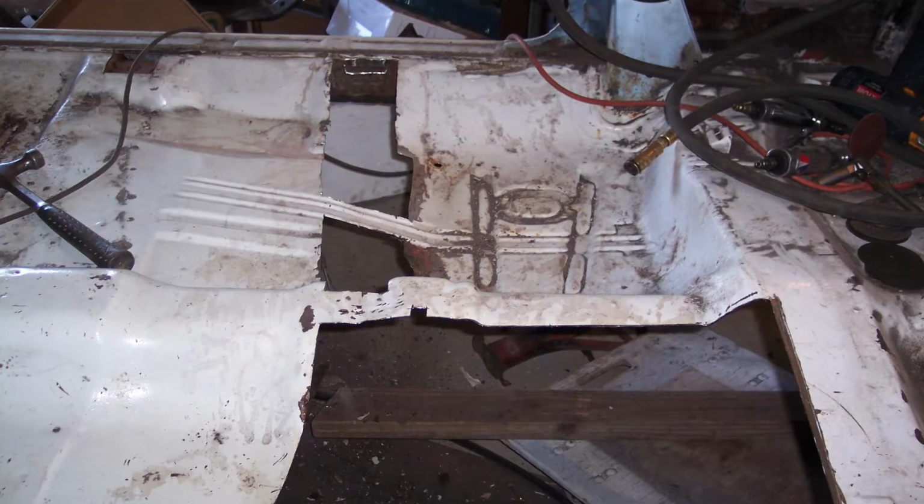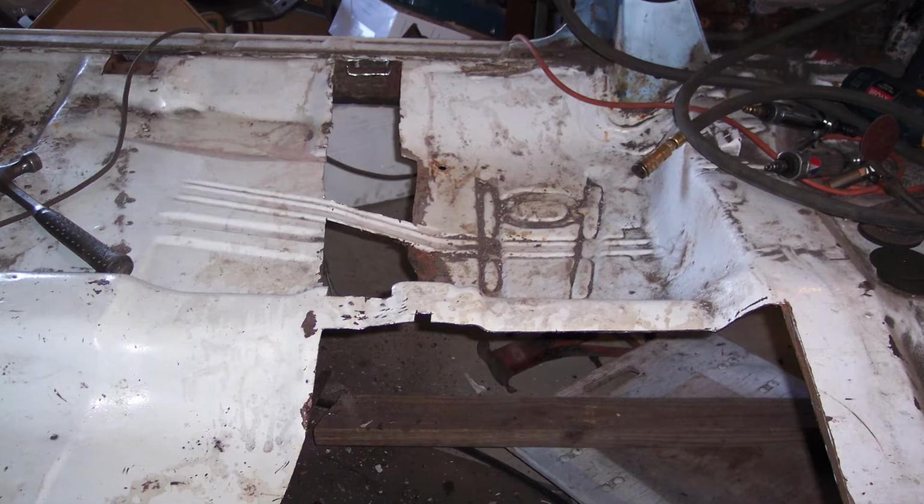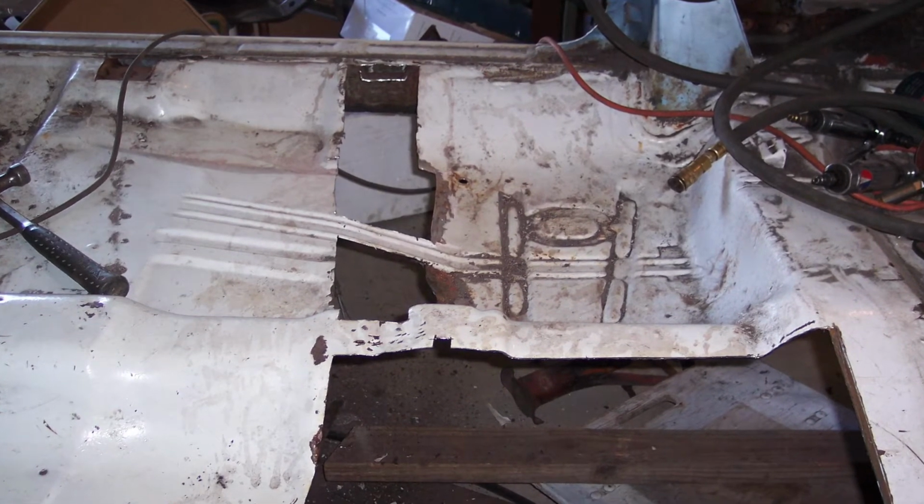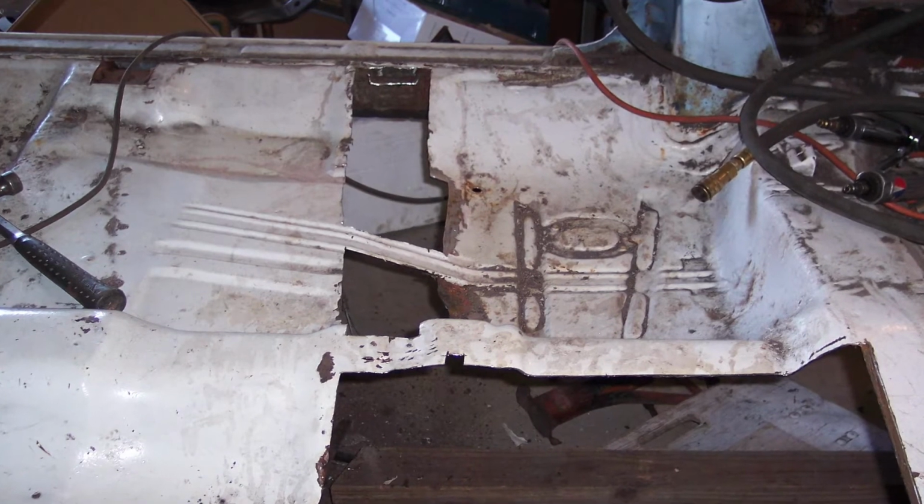So now that I got the trunk area all finished and completed, well, the car is still hanging on the scaffolding and everything is flat, and I've tried to keep the car as level as possible. And I have all of the body still braced so that nothing is going to get tweaked. Now's the time to cut out that floor brace, the brace that the back of the seats mount to, both ends of the seat belts. There's 4 seat belt areas.